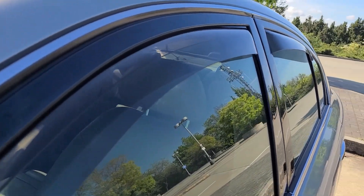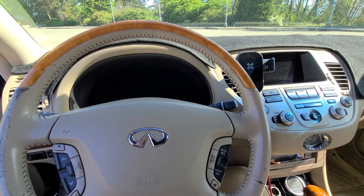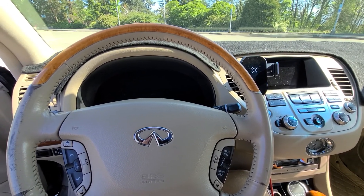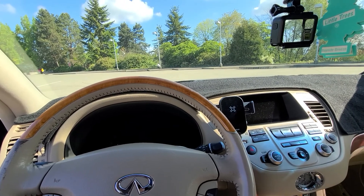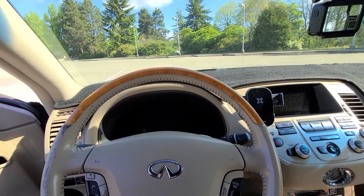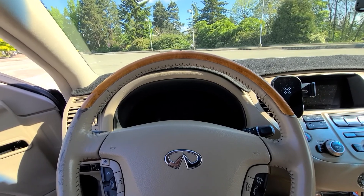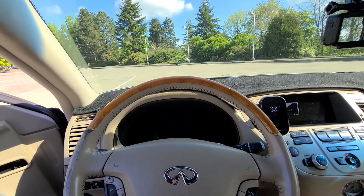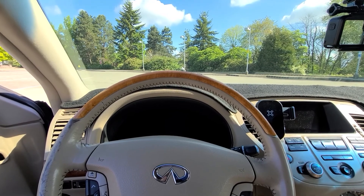We've got our cheapo eBay rain guards. One of the goals I had for this car was to be completely dry underneath. Currently both my power steering pump and rack, and both valve covers are leaking pretty bad — I've got most of the parts either on the way or at home. When I did the headers on the driver's side, it is very close to the steering shaft. So most likely when I replace the rack, I will have to change to a polyurethane bushing — that will eliminate a lot of the play and flex in the rack so that when I turn right it won't rub at all.